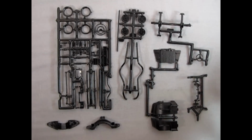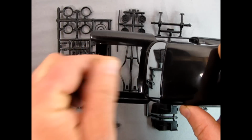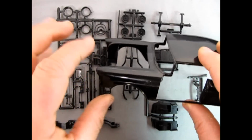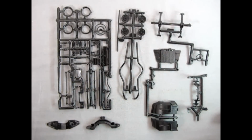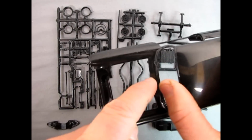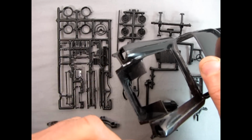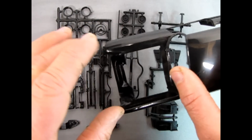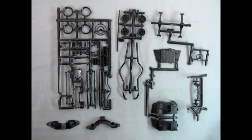And I just realized something with the Chevy that I just remembered with the body. There is not a cowl vent here. Chevrolet had actually lowered the front of the car from the 55 and 56s, and that's what those tubes are that go on top of the fender wells. Those are the fresh air intakes instead of the cowl up here, and they went actually through the front headlights. There's a little grill that goes around inside the headlight with the headlight in the center, and that brings in fresh air from the very front of the car into the passenger compartment. Forgot all about that, guys. I actually watched a video on the Tri-Chevys, and that slipped my mind.